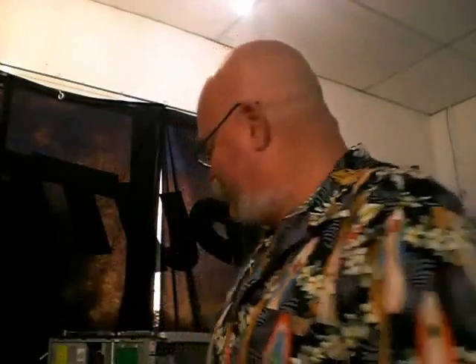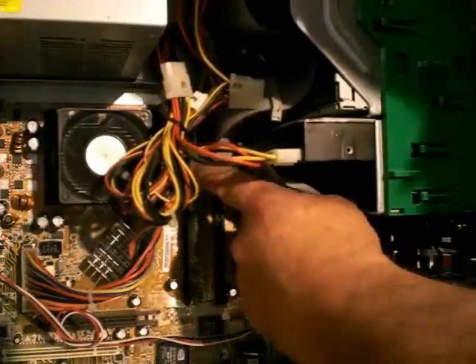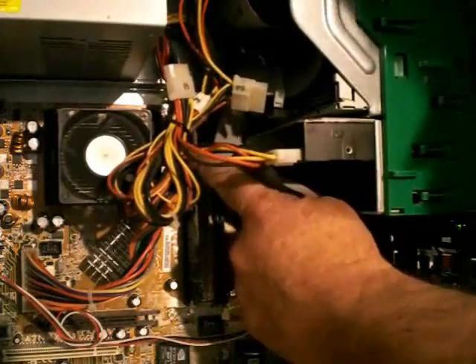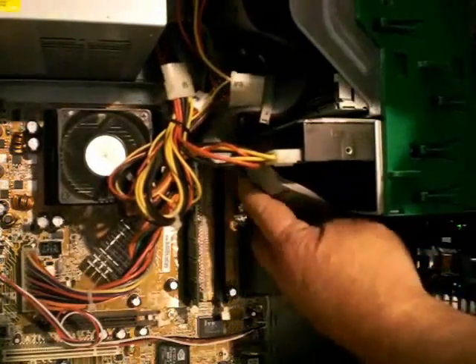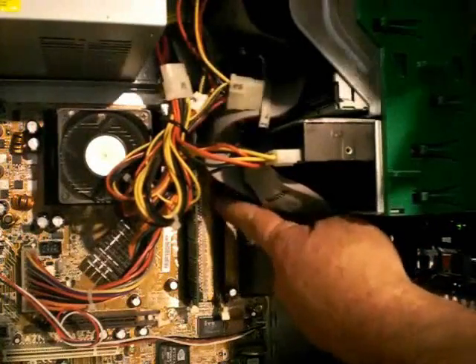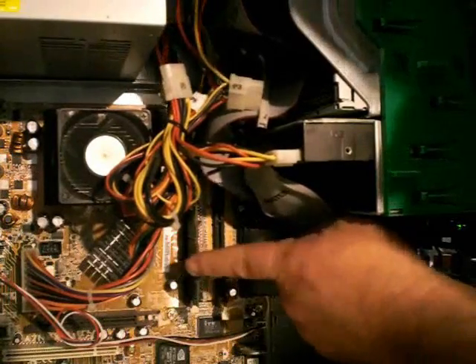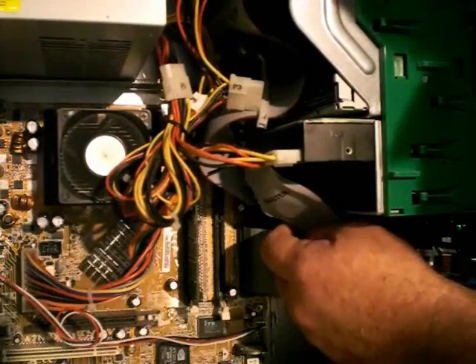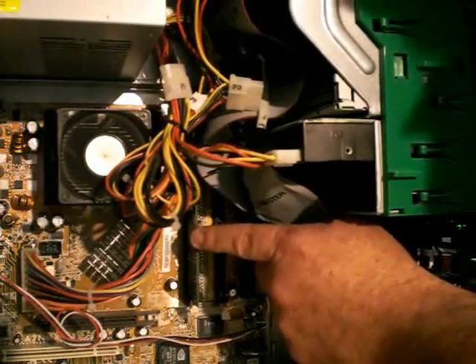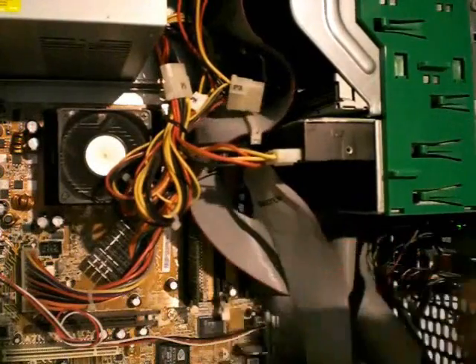So where is the RAM stored in your machine? Tucked in behind all this mess in here, you'll see your RAM. RAM is pretty much always in about the same spot. Some machines have one stick in them, some have two, and some have up to four sticks. This machine only has one. The most common issue with a machine not showing a signal to monitor is that this RAM is either faulty, dirty, or just needs to be reseated. So let's go and reseat this RAM right now.